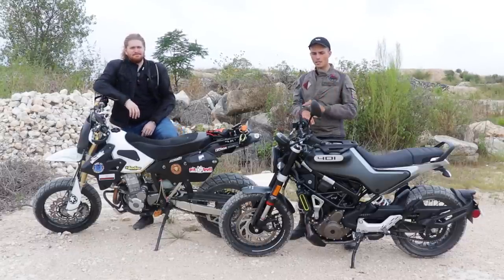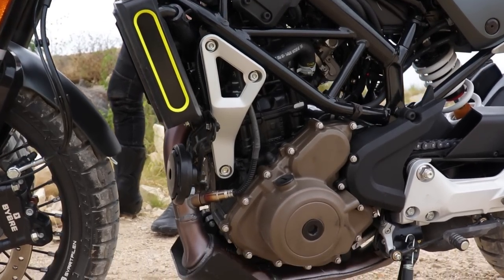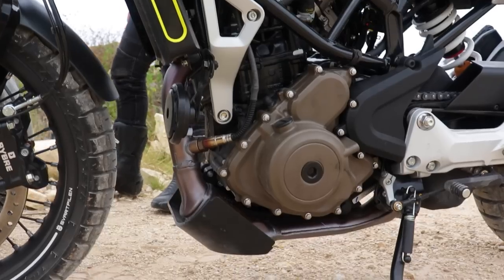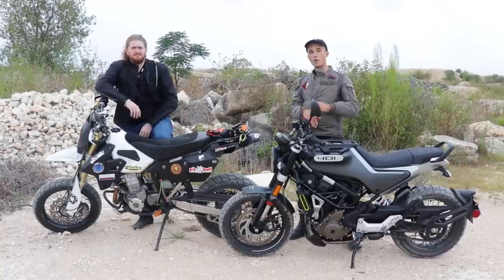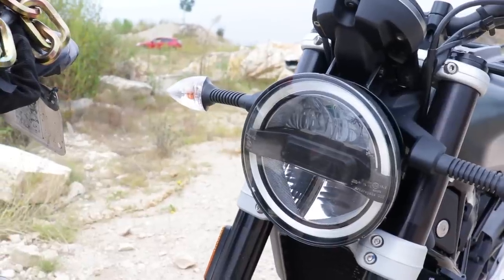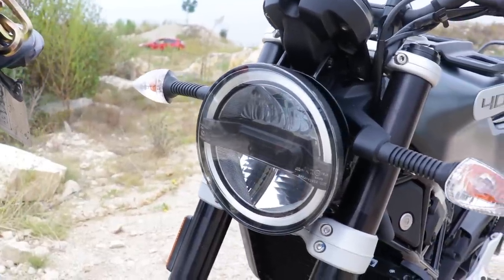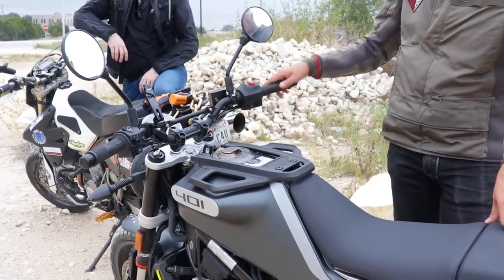The one thing that's going to hamper the Husky in this comparison is its ground clearance. As you guys can tell, the exhaust is routed pretty far down on this motorcycle, giving it about maybe four and a half to five inches of clearance. As many off-road riders know, unless you have 12 inches of clearance and competition suspension, you ain't going nowhere. We'll see how this thing does — it's relatively lightweight so I think it's going to be a ton of fun to chuck around.